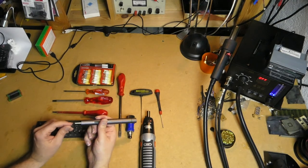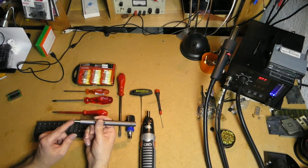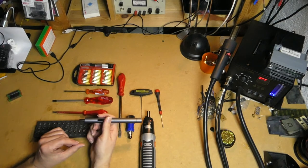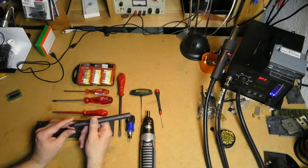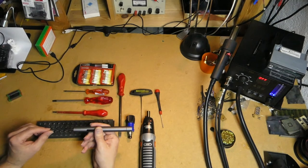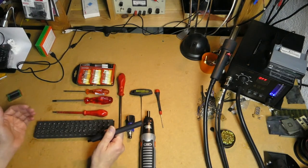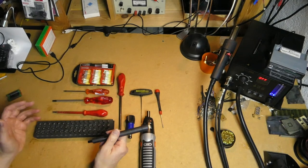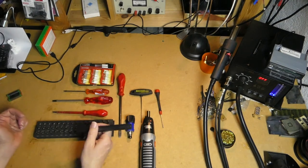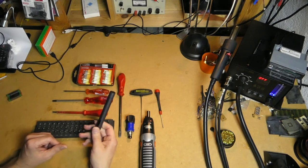The good thing about these is if you're not pressing the button to move them, they're actually locked, so you can break the screw free using your hand, and then just use the electric screwdriver to get it out. Yeah, and it's like a lot of modern electronics. You take a mainboard out from a laptop computer and it's like 35 screws, because the PCB is part of the load-bearing structure of the laptop computer, and they just make sure that they screw it down as often as they can. And that's a good thing, but this makes one of these tools even more valuable.